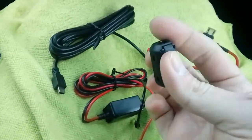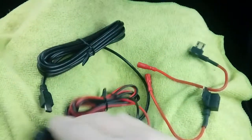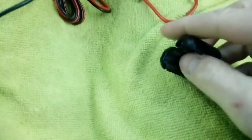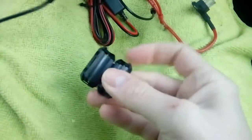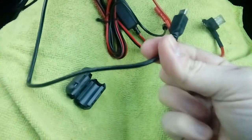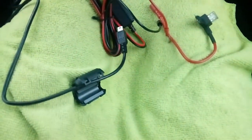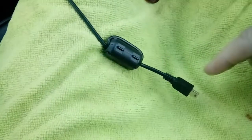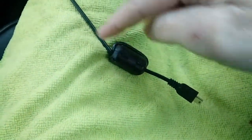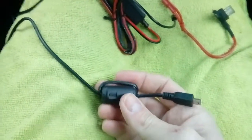On the end of it here there are two clips — all you do is pop them open like so. It's like a hinge, so just pop them open, spread the thing open. Open it up, then get the end of your cable, place it through it, wrap it around like this — there we go. So it's opened up, the cable goes through it, round it and out again, then squeeze it shut. And that's your ferrite filter. Without that, if you've got a DAB radio built into your car, you will notice a lot of interference generally speaking.